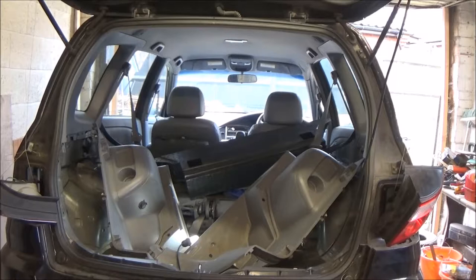It seems like you do have to take the lights off to get the bumper off. I still haven't got it off yet but it's nearly there. There are screws around the wheel arch — about one o'clock position on each side — and then three along the back edge of the mud flap area.